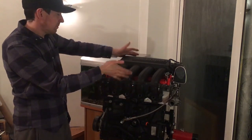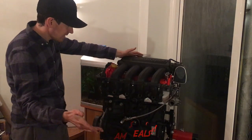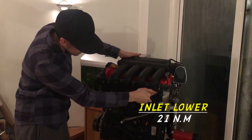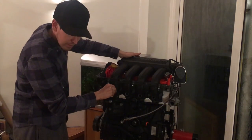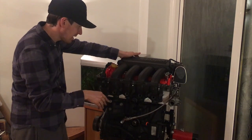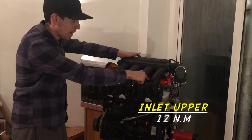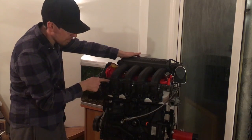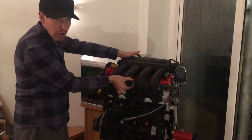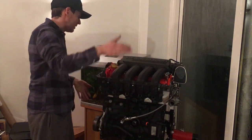And then your head's on — that's it, apart from the timing. Your head's on, your cover's on, your cams are in. The bottom half of the inlet goes on and they are 21 newton metres for your bolts along here. I think it's the same for your rail here — it could be 12, I'd have to check, I'll put it on the screen anyway. Top half of the inlet goes on — 12 newton metres. I've done the back ones to 21 but the little ones along the front are 12. I've actually drilled straight through — stud and nut all the way through — because they rip out, it's just easier, nut and bolt and it's done. Same on the back.